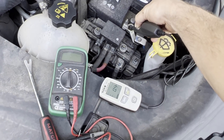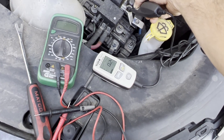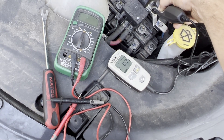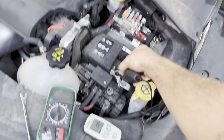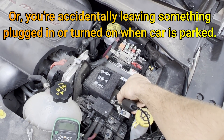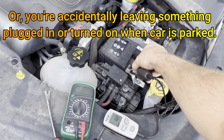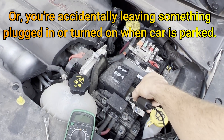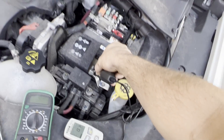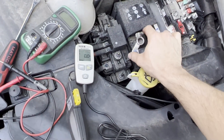You should not really see more than 0.2 to 0.3. I broke the connection briefly and it jumped up to one amp when I reconnected, but we are under the 0.2 to 0.3 mark. Nothing is drawing the battery down excessively, which means it's one of two things: either the battery itself is bad, or the alternator is not charging it sufficiently. Since it runs fine going down the road, I'm betting the alternator is fine — so I'm going with a bad battery.